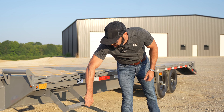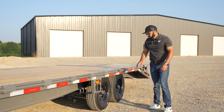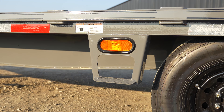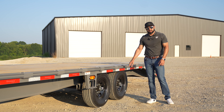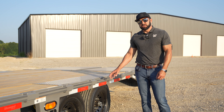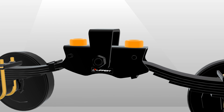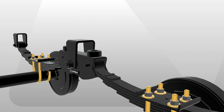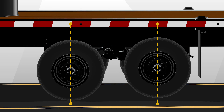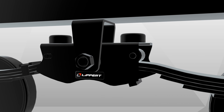We also made the retractable step standard — a nice little touch. Moving back, we made the midship turn step standard as well, so you've got a step there along with your blinker and midship turn clearance lights. It's two 7k axles, with two eights and 10ks soon to be available as well. Slipper roller suspension is standard, which is really awesome versus standard slipper spring suspension — it dampens your ride and lasts longer, with rubber inserts in the eyes of the bolts and bushings, and rollers for the springs to roll against.